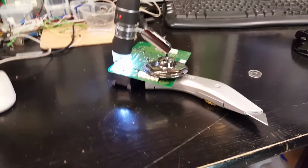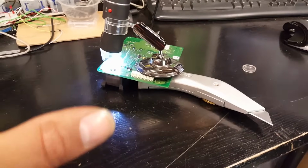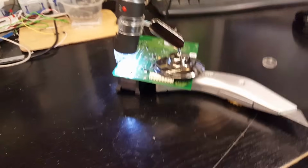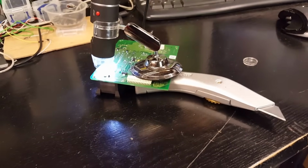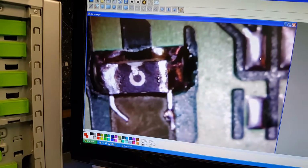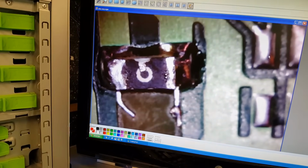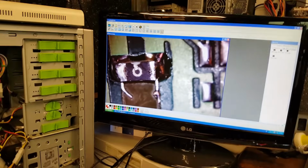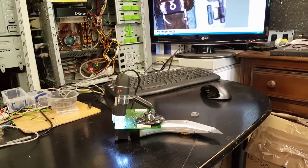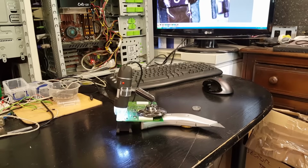So okay, I got it repaired, and before some of you guys start screaming, you shouldn't have done that, I know I shouldn't use this as a fuse, but I've done it. Why? Because I can, basically. So what I've done, guys, is I've used a 0 ohm resistor to jump that. They can be used as a fuse when they have the right values and tolerance. I got it out from that board, so I don't have a clue what the tolerance is. Doesn't really bother me. What I'm going to do now is try it and see what happens.